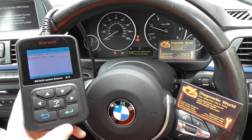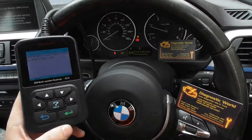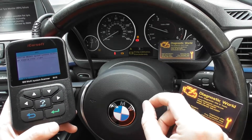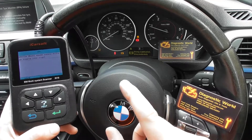What we really need to do is simply change that out — put a new ABS sensor in — and that will allow us to erase the trouble codes and get rid of all these warning lights as well. It's a common problem; you're not alone if you've got these warning lights on your dashboard.